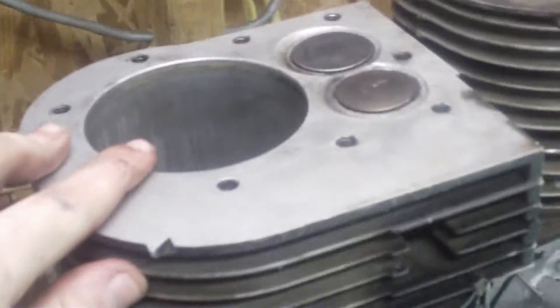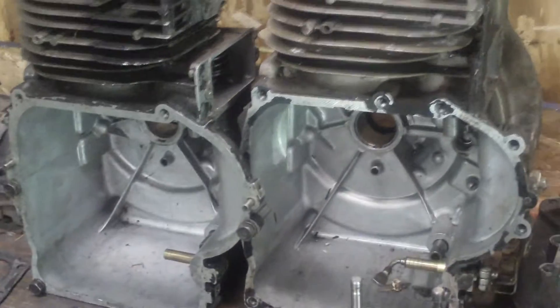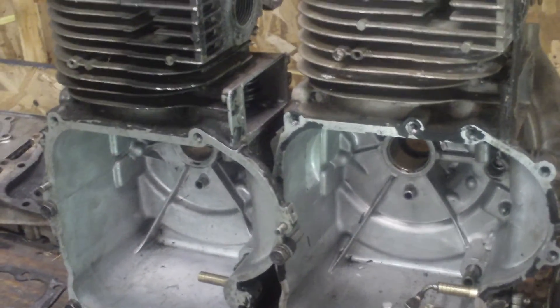I did try to do this — I put it together and on top dead center the piston stuck out of the block a good quarter inch — or maybe an eighth, somewhere in there. So you'd have to work on the head too, machine the head a little bit for clearance. Well, there you go — if y'all have any questions, just message me or leave a comment.